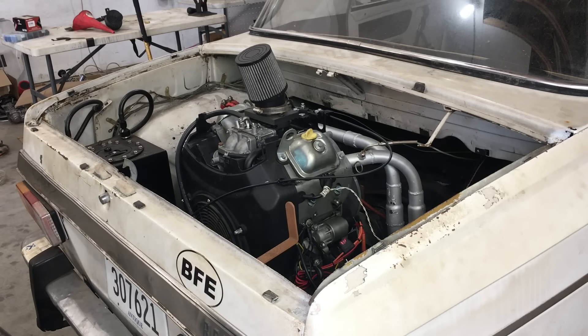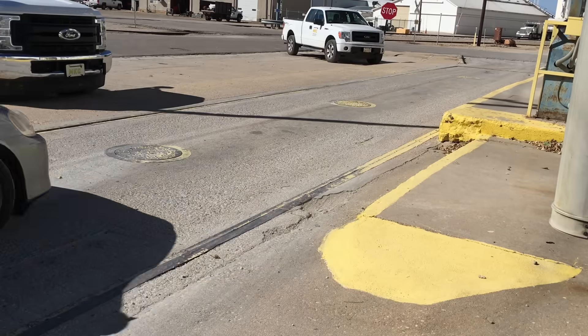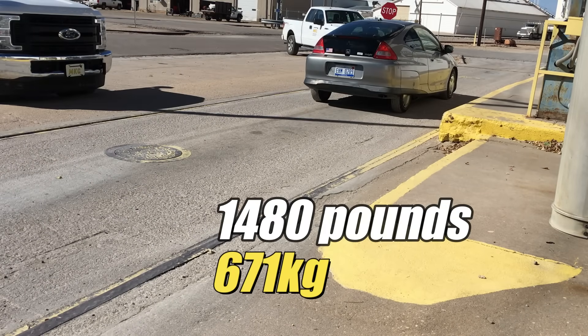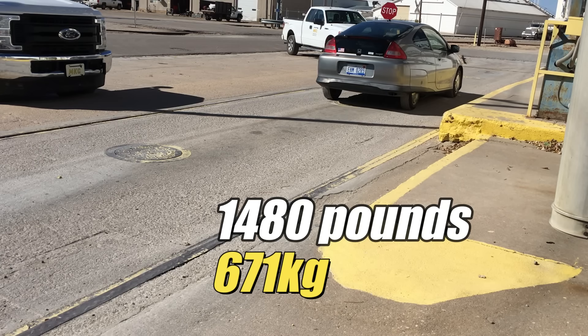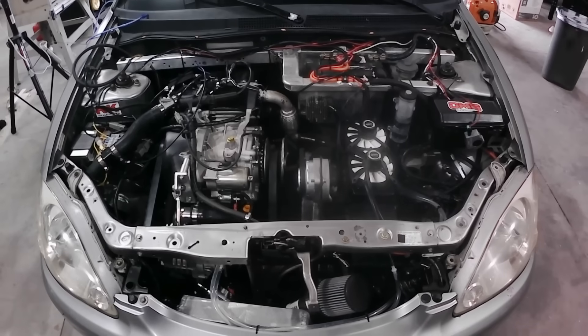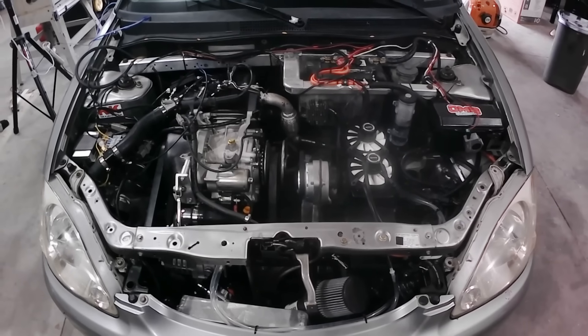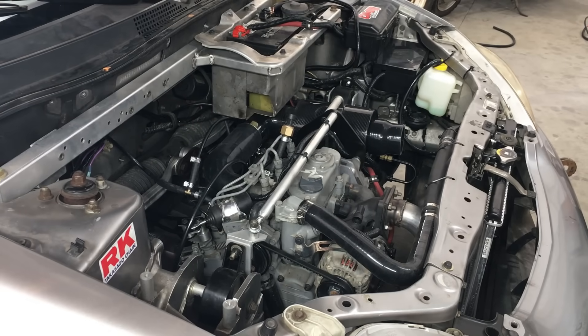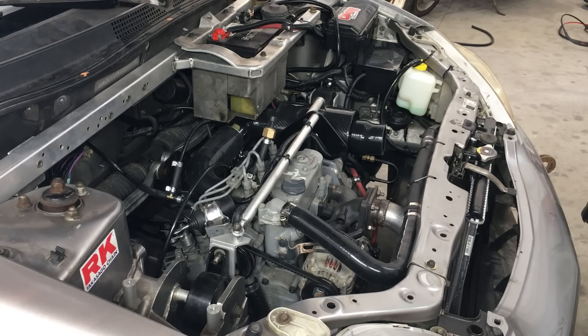The 670cc Predator engine in the Renault makes a little bit more power out of the box, so which car is going to be faster? Well, the Renault makes more power but it's also heavier. The last time we had the Honda weighed, it tipped the scales at 1,480 pounds — with the 420cc fuel-injected supercharged Hemi engine. That engine was certainly a lot lighter than the diesel engine we just swapped in. However, in order to make the Predator engine fit in the Honda, we had a fairly heavy engine mounting cradle along with some jackshafts. This diesel swap probably only added an extra 50 pounds to the car, but that's just a guess.